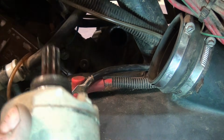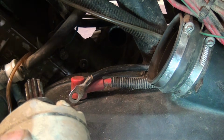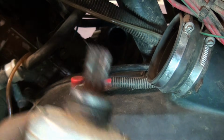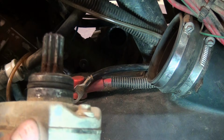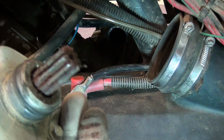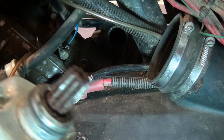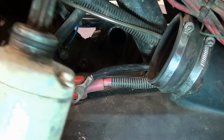and now it squeezed right out by. Now I will say that I bought a starter with the Bendix. It was about $55 I think on eBay. You can get the starters themselves without the Bendix for I think around $35. I'm not going to change the Bendix out today, but I'm assuming by the looks of this gear that I've had water in my case on the other side, so I'll want to replace that Bendix here at some point. I'll do another video on that, and I'll link to it right here.